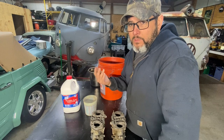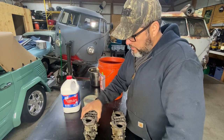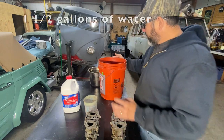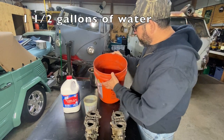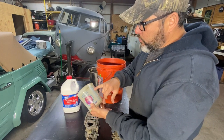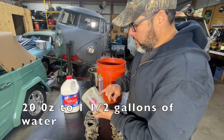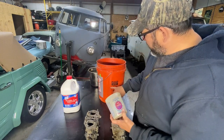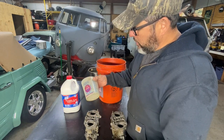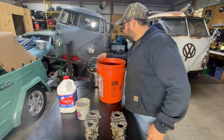This is an experiment for me, like it's gonna be for you. If it does work, the carburetor should come out really really nice. The process calls for one and a half gallons of water in a bucket with something to measure with — he used 20 ounces to one and a half gallons of water. I've got about two and a half gallons of water so I'm going up to 24 ounces, just to have a little more kick.